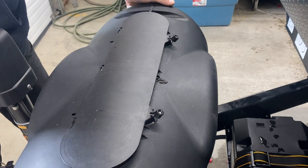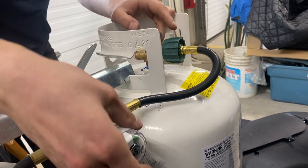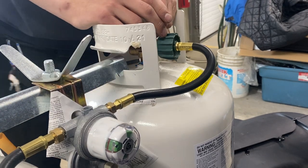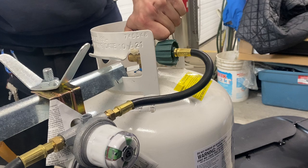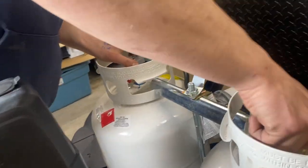Underneath this cover, push those knobs back to access the two propane valves. The indicator in the back is currently green, letting you know there's propane present, and the arrow is pointing to the tank we're running off of. If it goes red while a tank is open, that tank is now empty — close it off, flip the changeover to the other tank, and run off that one while you get the empty tank refilled.